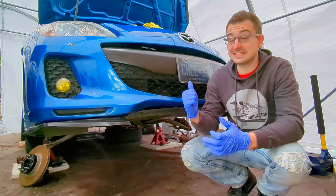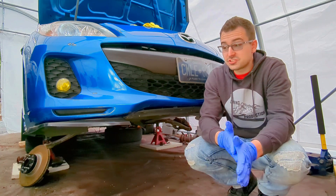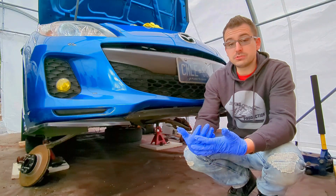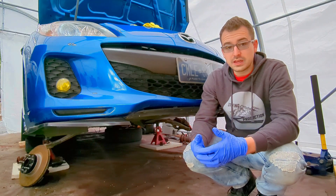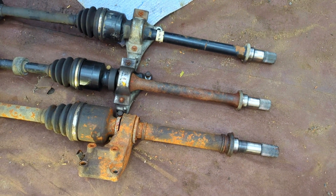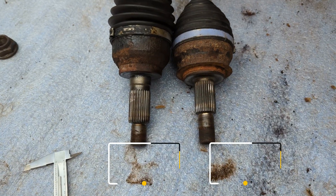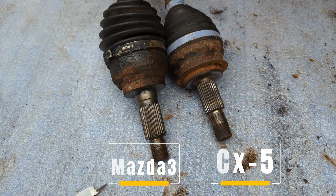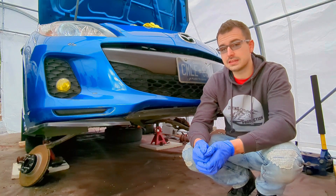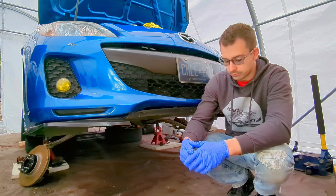The transmission is installed in the Mazda 3. Now it's just a matter of what to do with the axle situation. I finally took out the axle from the hub. With that done, I can now compare the axles properly and see the differences in size. Unfortunately, the CX-5 axle doesn't go in the hub for the Mazda 3 — the axle is still bigger than the factory Mazda 3 axle. So we'll have to figure something out with that.